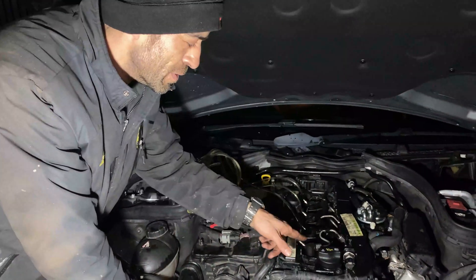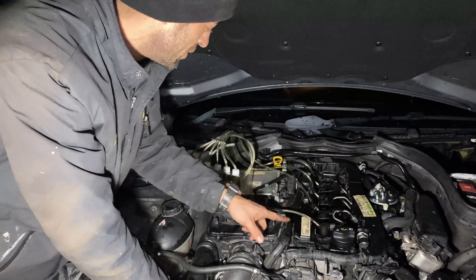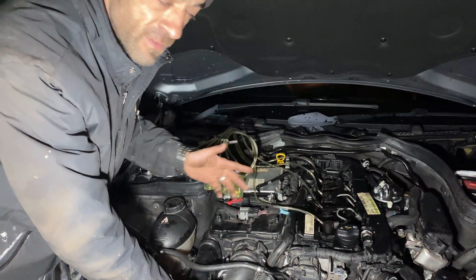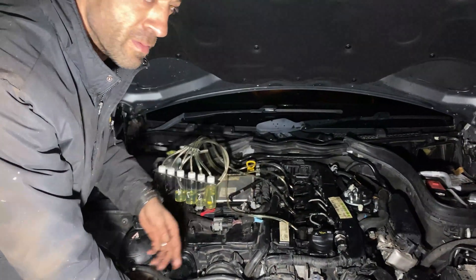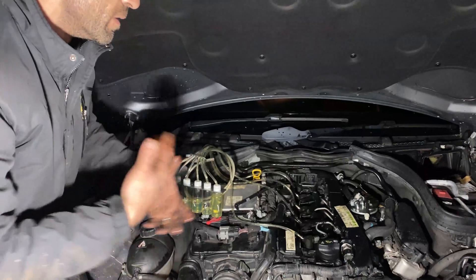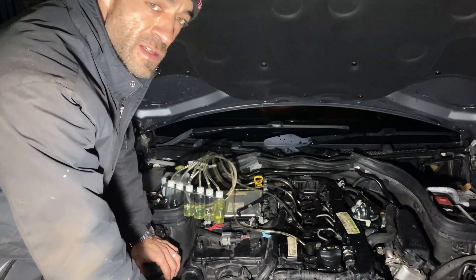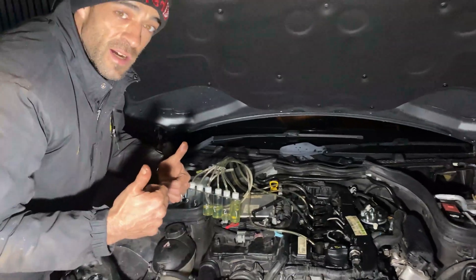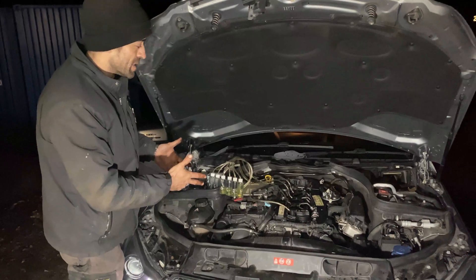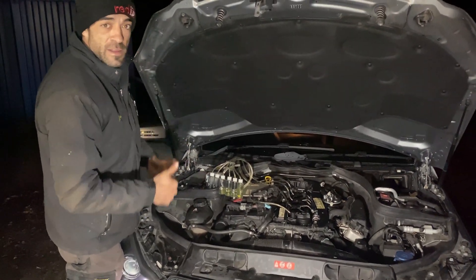The one return line that's pushing back so fast and hot actually popped off, and that's leading to our problem. So definitely a problem on injector one. We did clean the nozzle hoping it would be better, but it's obviously in need of refurbishment. We'll buy a refurbished unit and show you guys how to actually change an injector. So stay tuned — like, share and subscribe. We're getting the content out there and hopefully you've learned something. See you on the next one.